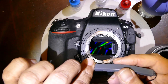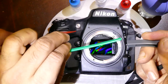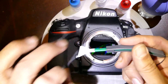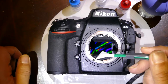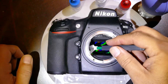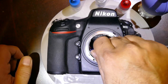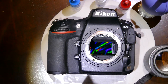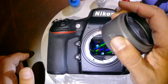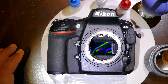If the sensor requires a second pass, just reinsert the swab. Take the swab out, turn it 180 degrees, and reinsert it back to use the opposite side. Again go in the same direction. Take the swab out, do the inspection. Once everything is completed, stop right there.